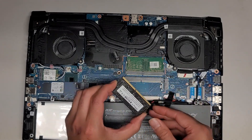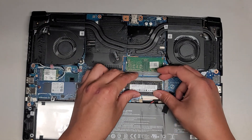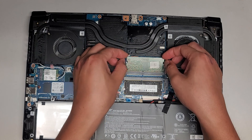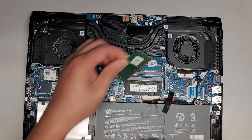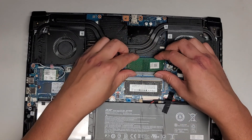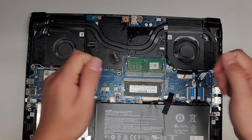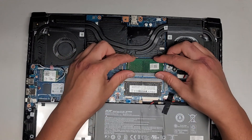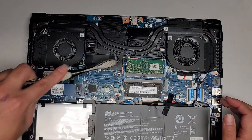I'm going to just wipe the contacts of these sticks of RAM — sometimes they can cause issues. I did run MemTest and it didn't have any issues. I'm thinking it's a motherboard issue because the computer worked perfectly fine when I was running a GPU stress test, but when I picked it up to move it somewhere, that's where it had issues. I have a feeling there's probably a micro fracture in the board.